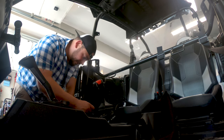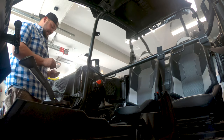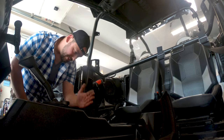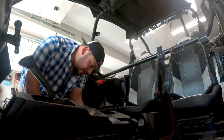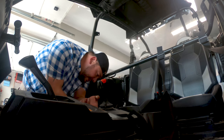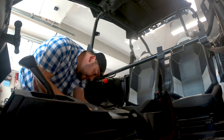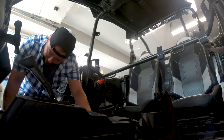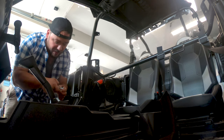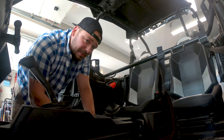I reused this nut and bolt so I can bolt the harness into that slot. Again, you can move it to the back which will bring it further back — I'm using it here because it still has a little bit of an angle and it looks good. Then you're going to get into here and take this buckle out, which is a different size. I'm using 13/16ths on this one, and then the 16 mil once again — so don't put that away. Both sides are exactly the same, and you're going to want to keep this bolt as well.